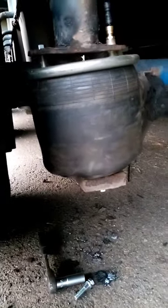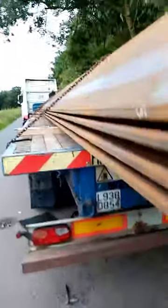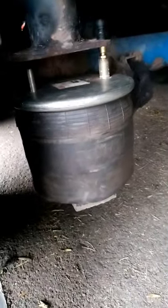Right, it's an awkward one guys. The axle's kind of twisted the way it's parked, so the bags are leaning over at an angle — if you get a look at this one here, the bag is twisted over so I can't get it on its mount. I'm going to get it to trundle forward, put on a hard lock, and that should click that axle back over a bit and line it up. Right, I've got it to pull forward slightly at an angle — so that's put the bag in a better place. The axle's kind of skewed over, so I should be able to pop it in there now.